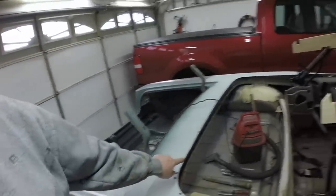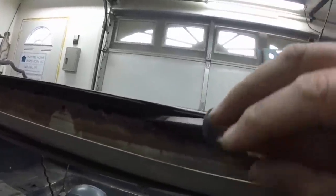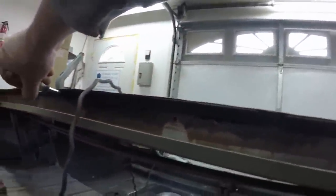I started cleaning out this channel here and found a little bit more work than I had expected, so let me show you. I got a weld in a little metal in there too, so that'll add another day or two to the job. Some of these holes were pulled out from the bolts, especially this one and these two on the other side. This one's a little pulled out here, but not bad. But I was taking my screwdriver and scraping the surface rust off, and it went through across there, there, and there, and a spot over here.